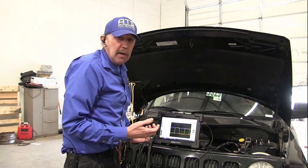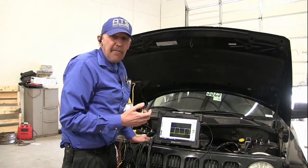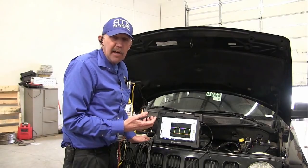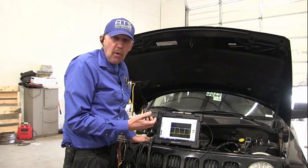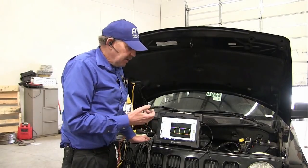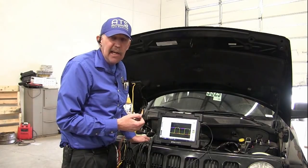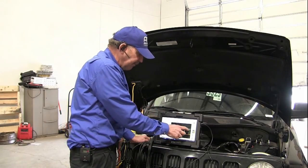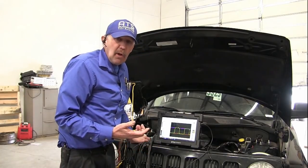And then when I find out that the crank sensor is some cheap aftermarket sensor. I've had more problems with cam and crank sensors from aftermarket than probably anything I've had on a car. These sensors have to be made by the OE specifications, and sometimes the aftermarket companies don't do that. And Jeep has a little bit more noise on the crank sensor from the ignitions than a lot of cars I see anyway. Like a lot of times when I'm looking at these engines, I'll see strikes coming off of the crank sensor, and that's normal. I don't freak out on that.